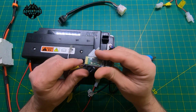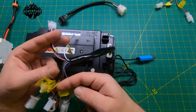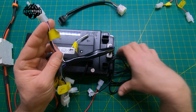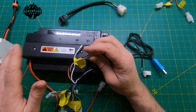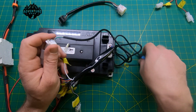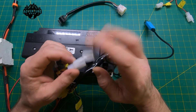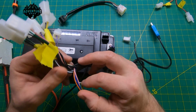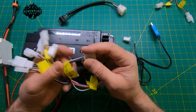I'll be using a little Bluetooth dongle to remotely program it so I don't have to run 5 volts separately — it's actually in parallel with the throttle's 5-volt line, which is pretty handy. If you're programming off a computer, you don't need that. What you do need is to power the unit up with the e-lock powered up, then plug the cable in with the computer powered up. If the drivers are installed you should be able to connect — that'll be a separate video, but it's surprisingly easy even though the GUI is MS-DOS flavored.